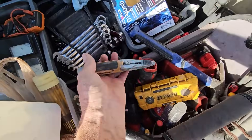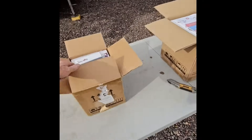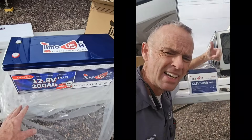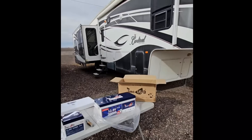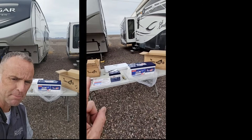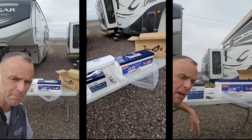If you follow this channel long enough, you might know how much I really like and encourage the use of lithium iron phosphate batteries for RVs. Weight, power density, charging speed, and safety are all important reasons to choose them over lead batteries. These lithium iron phosphate batteries have a built-in BMS — a tiny intelligent computer inside that turns the battery cells on and off depending on conditions. If your charge voltage is too high, it prevents charging to avoid damaging the cells. It also regulates current in and out of the battery, which lead-acid batteries don't have. That's why I generally don't recommend using lithium iron phosphate batteries as engine starting batteries.